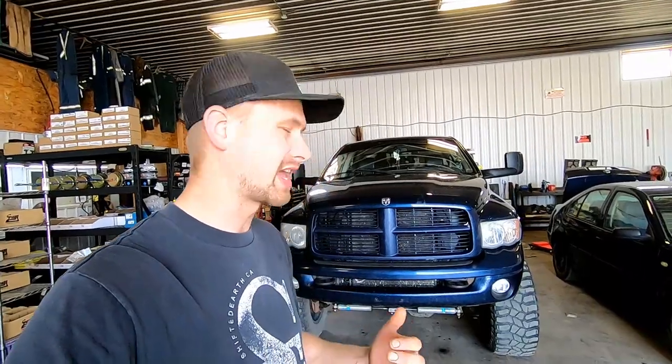What's up guys, today I'm going to be installing my new turbo on my 5.9 Cummins. The turbo I went with is made by BD Diesel and it's their performance Howler kit. Essentially it's the stock turbo that's on a 6.7 Cummins, I believe 2007 to 2012. They hone it out from 60 millimeters to 64 and a half. It's also a VGT turbo, so you get a whole wiring harness, a whole new VGT module, and everything to run that on a 5.9 Cummins.